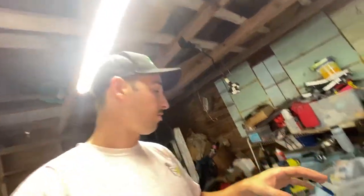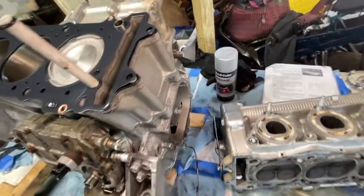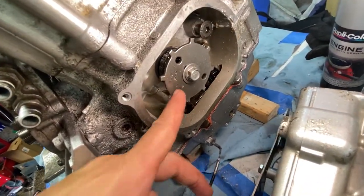But yeah, I'll throw you guys up on the ceiling, show you how to put the head on, we'll torque it down, and then the next thing we'll be doing is putting those cams in, putting the cradle on, and setting all our fun timing stuff. A good place to start is have your motor already set to top dead center. So see this line with the T here?